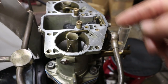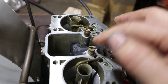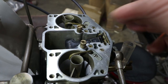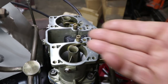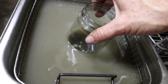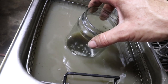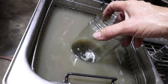Basically, the port at which the fuel dumps into the carburetor through the mains is at this height right here. You want the fuel level to be lower than the port where fuel just dumps into the carburetor at all times, but obviously you need a little bit of fuel in there as reserve so when you want to accelerate you have enough gas. The needle and seat are in this jar in the ultrasonic cleaner getting a thorough cleaning — it's actually a mixture of gasoline and diesel, sometimes used to clean small parts.